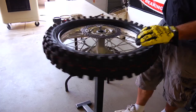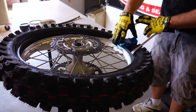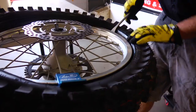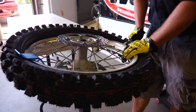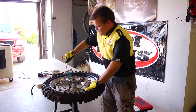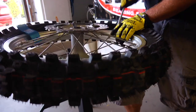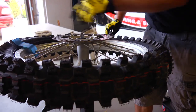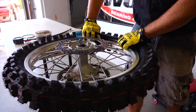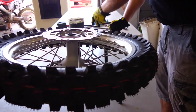On our last side we put our spoons about five inches apart, hold them like this, put one of these bead buddies in there. Now I'm taking bites about an inch and a half apart and I'm pushing down on the tire to keep it off the bead. On a rear you just want to take your time and take slow bites. Even as you get going, come over here and knock the tire off the bead, pushing really hard to make sure the tire stays off the bead all the way around. Probably just one more — slide it in real careful. At this one I can hold down and it pops right in because we've got some nice lube on there. Push down, pull the bead buddy out.